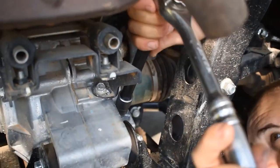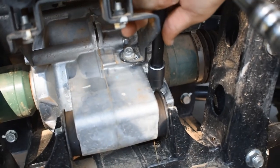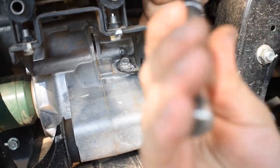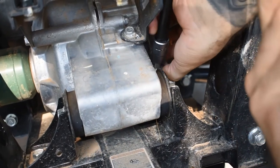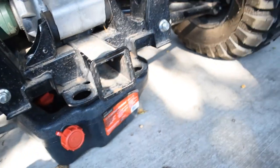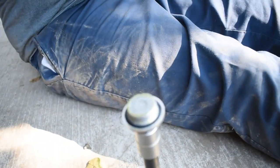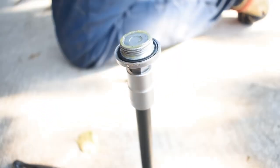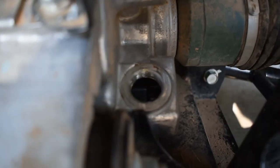We had some camera difficulties. There's a 17 millimeter hex down here at the bottom — it's the only 17 millimeter down there — that's the drain plug for the transmission rear drive. The top fill plug is a 14 millimeter Allen head. This area was extremely dirty so I cleaned around it real good. The plug is clean and this transmission case holds 2.1 quarts.